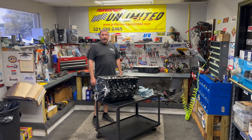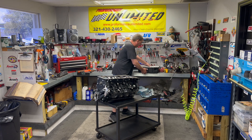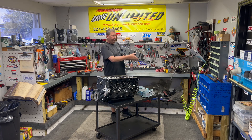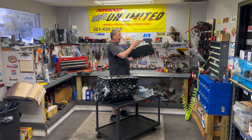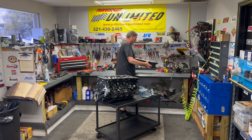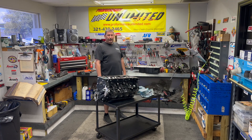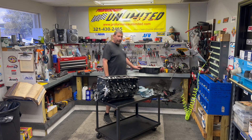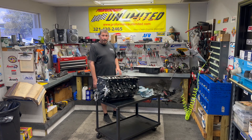I got the oil pump, front drive oil pump installed, and the timing cover. Now I've got the Holley F100 pan boxes opened up and laid out across the bench here. This happens to be the oil pan that Holley designed for the F100. What makes it a little bit different from the standard pan they offer is this is a little bit shallower and a little bit longer than what I'll call the Mustang 2 oil system. That'll help the F100 gain a little bit of ground clearance. There are a few other vehicles I found it'll work well with too, especially for guys trying to build low riders — it'll save you about two inches of room. Really smart idea.